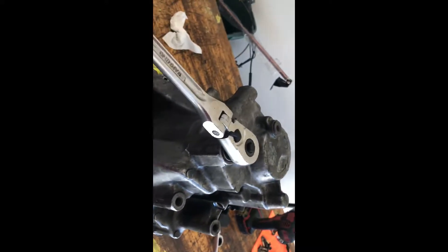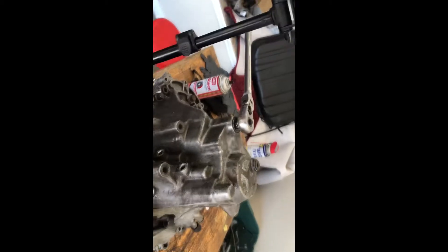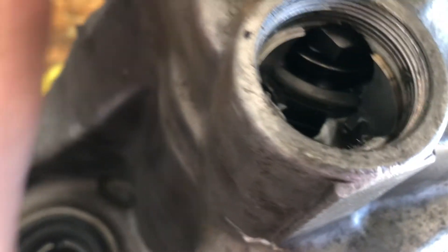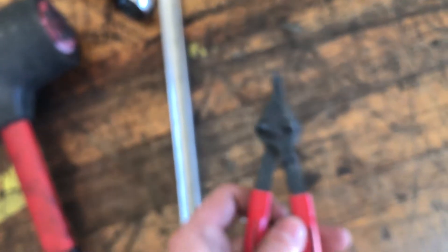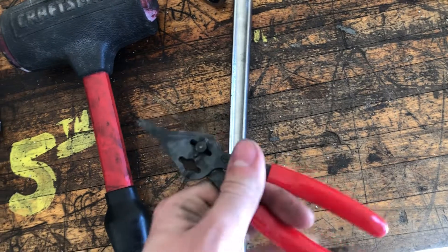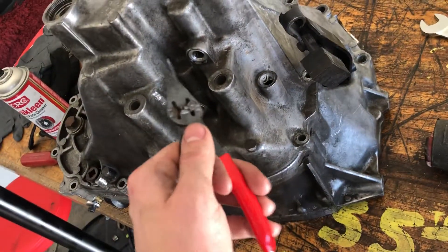I've got some crud built up — I'll get that out real quick. This is for a half-inch drive. Make sure you get a good seat in that. I'm going to use a ratchet; you can use a breaker bar if you want. We need to get this off so we can get down to the snap ring inside. Those two rectangular tabs sticking out need to be spread, then you should be able to bump the case. This would be much easier with the right tools — snap ring pliers that expand when you squeeze. I don't have those, so I'm going with the old-fashioned mallet to unseat the case to the point where I can pull it off.